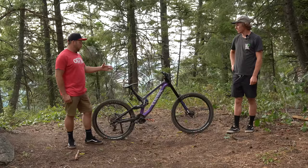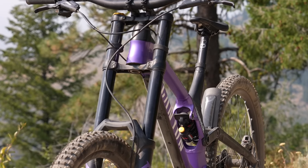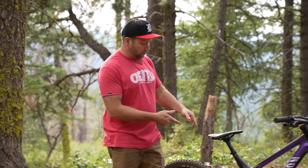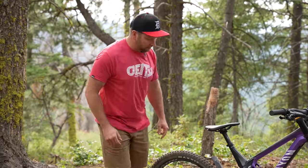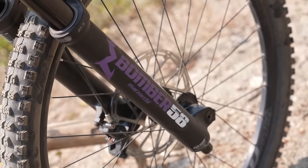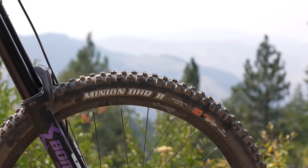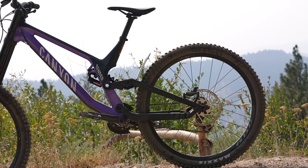I picked this bike up from Jason after he rode it and didn't change the stack height — he had it nice and low the way I like it. I was really psyched on the flat crown on this Marzocchi. I rolled my bars back a bit more than Jason had. I put the heaviest Sprindex spring we were sent for testing, set it up at 470 pounds. Suspension PSI was 95, same as the Fox 40 on the YT, and I found myself backing compression off with the Marzocchi. Tires: 31 rear, 28-29 front. I ran the chainstays in the long position the whole time — that felt like a very familiar chainstay length for me.